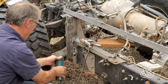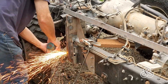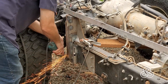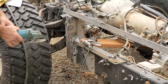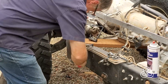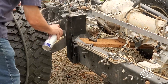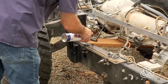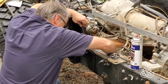I want it nice and smooth and clean because this might be an area where you need to climb under the vehicle to check the suspension or deal with obstacles on a 4x4. So get it all polished up, take off all the sharp edges, clean it up, and get it ready to seal and paint. I have some rust-inhibiting paint — a primer-based product sold by Eastwood — that I'll be coating these things with, then coming back with a good chassis black paint to finish them up. I'll spray into those cracks and crevices as best I can to seal this up. This paint can also has a little tube that I can stick in to paint the insides of the chassis rails.